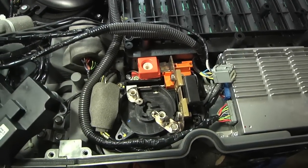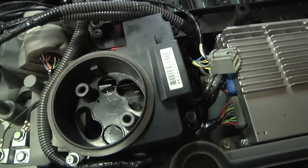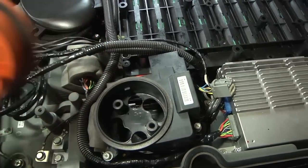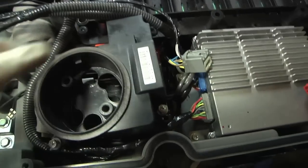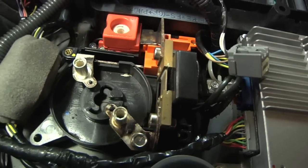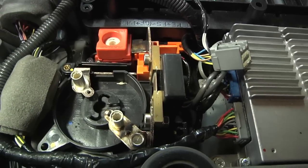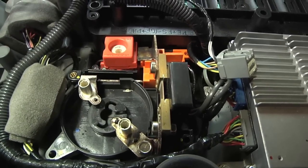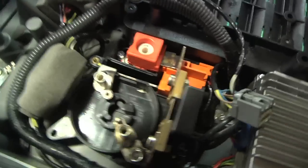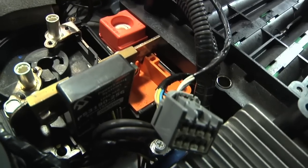I just disconnected the service port — basically that's a cover, and when the battery pack's actually in use, this big plug goes in there, and that has a fuse. When you pull it, no battery pack power. And if you look at where the connections go, it looks as though this connection connects the top half and the bottom half — these two layers of cells together — making essentially a 300-volt nominal battery pack. You've got 150 volts on the top layer and another layer beneath it, connecting right through here. There's also a shunt for an ammeter right here.